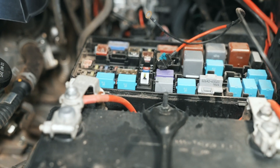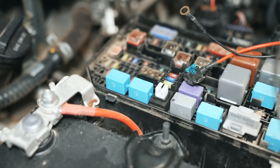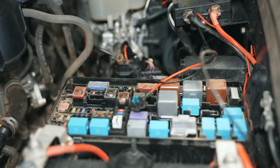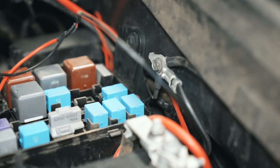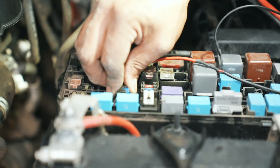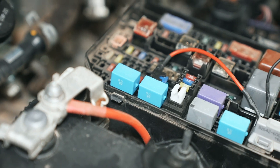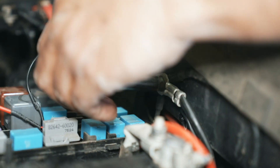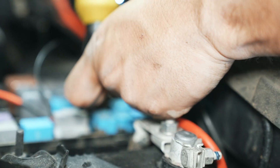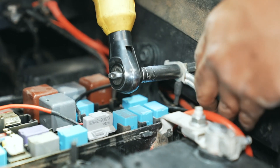Next up, access the fuse box in the engine — we've got the cover pulled off. Go to the fuse INJ. With the added fuse, you guys will need to go in there, and there is a ground wire that you will just install right here on the fender wall. Once you have it routed where you need it to go, add a fuse to the added fuse because it only comes with one. Then plug it into the INJ. Over here, take off the 10mm, add the ground to that, and tighten it down. Then put your fuse box cover back on.